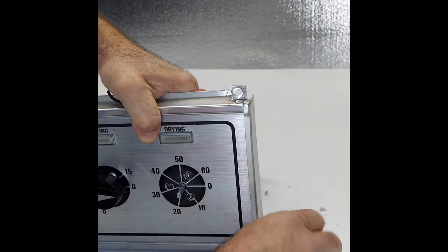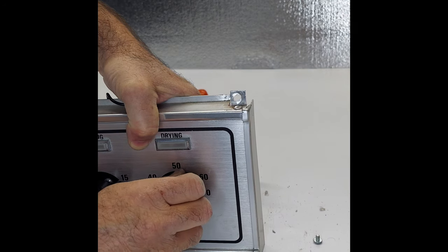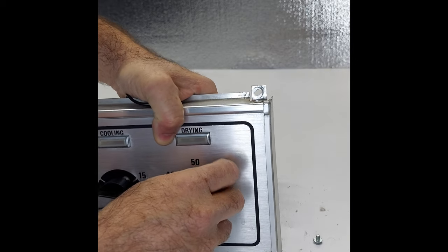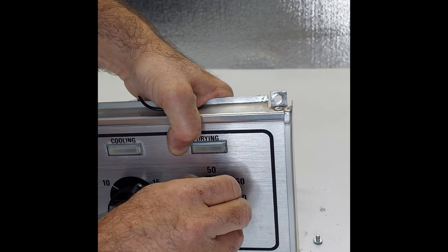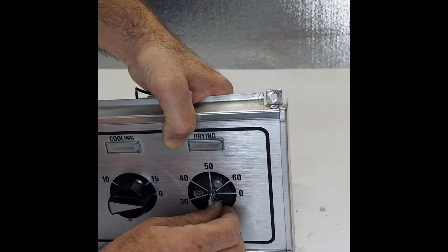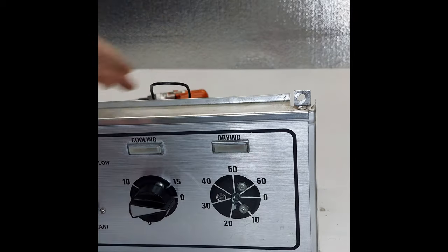We can turn it around. Now we gotta put the screws back. Make sure that they're aligned. We put one of them in there. Make sure it started with your fingers. Don't use the drill to tie a screw at the beginning, because if it goes in wrong, it's gonna strip the screw or damage the switch threads, so I won't be able to do that. The second one. And the last one.